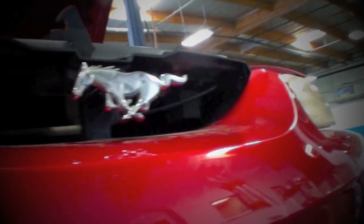To finish the installation, you need to lay on the ground and place the filter up in front of the fender liner, behind the headlight, onto the end of the inlet tube where it's protruding into the fender well. We lifted the car and backlit it here to show you where it goes. Now we can run this car on the dyno and see how much power we picked up with these super easy and affordable bolt-ons.